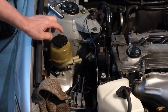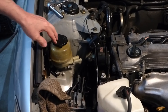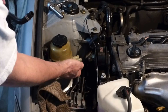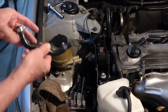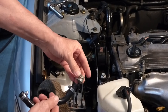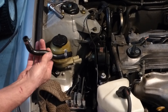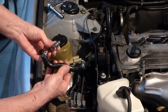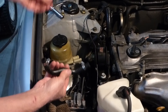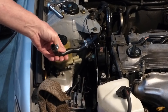So I also took the reservoir off, capped these off, and put pressure on the reservoir — no leaks there. But I definitely had a leak here on the return line. So I'm going to replace these clamps with hose clamps that I can hand tighten. I had a hose clamp on the top but it was really too big and too long. I'm hoping this will fix it — I'll install it and let you know how it works.